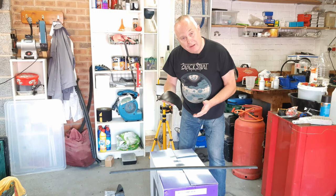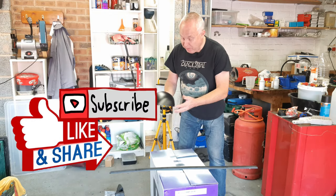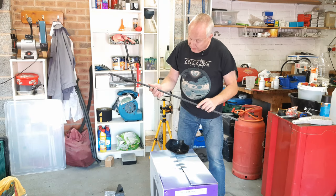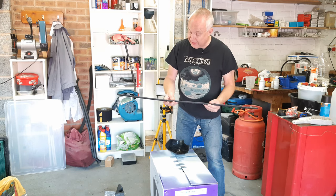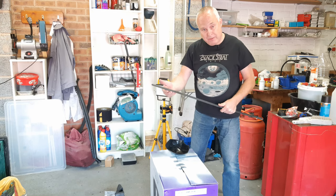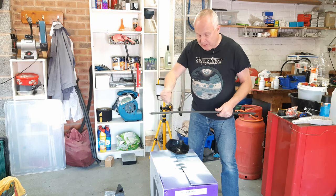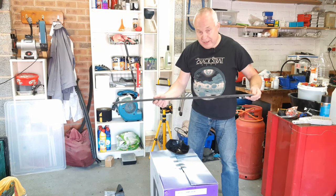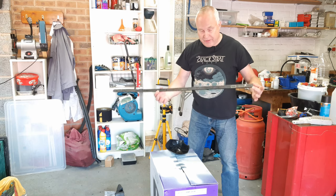First step: clean your parts. If they're brand new and they've come to you in a sealed plastic or paper bag, you probably won't need to clean them. If they're parts off your car that have lived on it for a few years, like this door trim, it's very important to give it a very good clean — dirt could contaminate our paint job. Use a bucket of warm soapy water, a bit of washing up liquid, and a brush; give it a good scrubbing, then rinse thoroughly and allow it to dry.